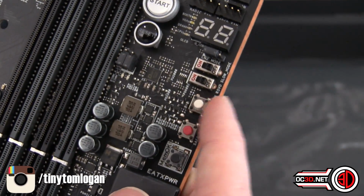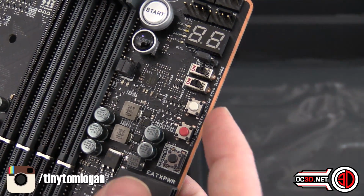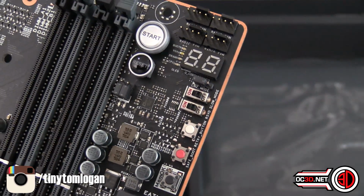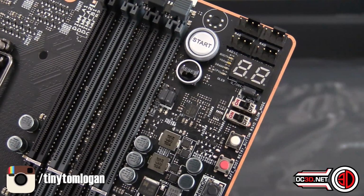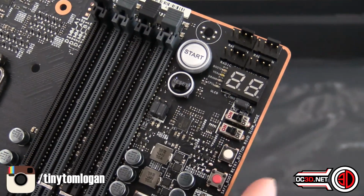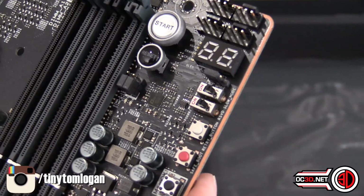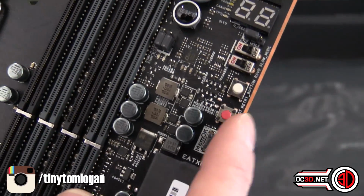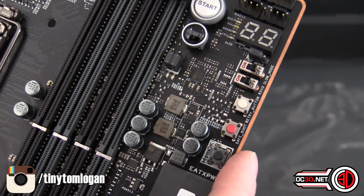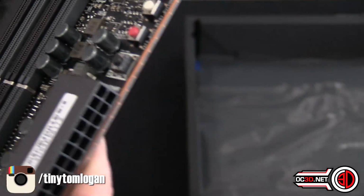Sometimes, I love this, sometimes when you're doing an overclock, it looks like your overclock is frozen on boot, but you can smash the retry, rather than resetting the system, and then when the system boots again, it goes into that Windows repair malarkey. This is just a very clean reset without it getting triggered into the operating system. Safe boot, you can actually set up a profile, so if you smash that button, it will boot up at that specific saved profile. That's really handy. Memo K, I still don't use that very much.